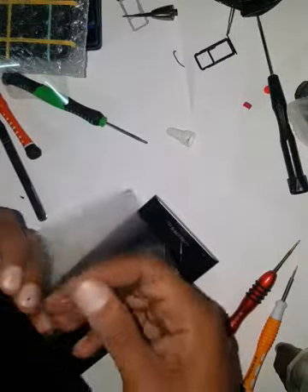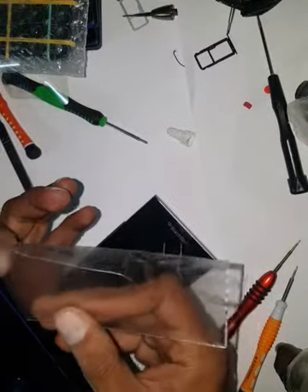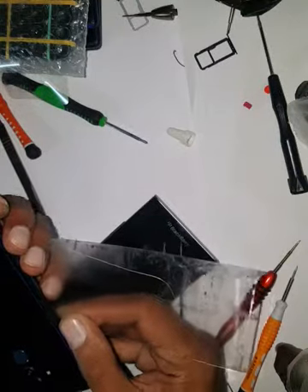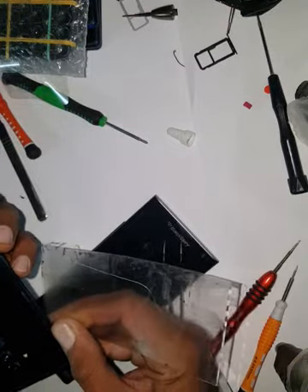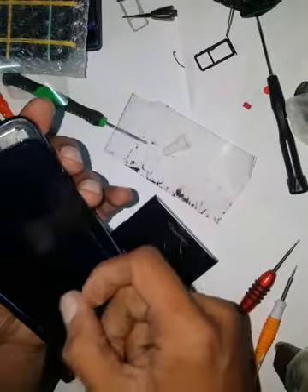There are the sensor button flexis, so once you have opened it halfway or more, be careful — don't go too far on top with whatever tool you're using. Just take the corner and work it out around. If you need more heat, heat it up. There is a risk of breaking something — it is plastic here.